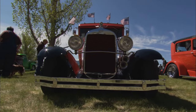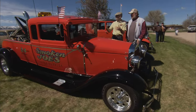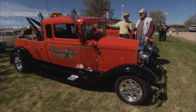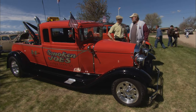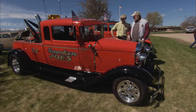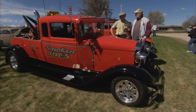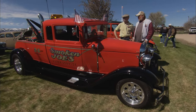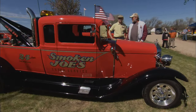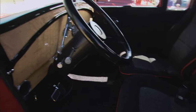It's an all-steel cab. The fenders are glass — front and rear, the only thing that's glass. And it wasn't this long originally — I put a 12-inch extension on it. The old Model A's didn't have much room to drive, and you're a big boy. So I found a back window — an opera window out of a '28 four-door sedan that matched the body line — shortened it down and added the foot onto the cab. Then flush-mounted the doors and suicided them. You can really move back there and get some space.